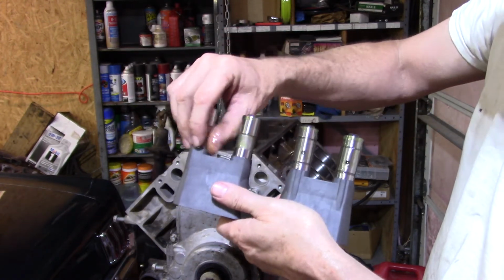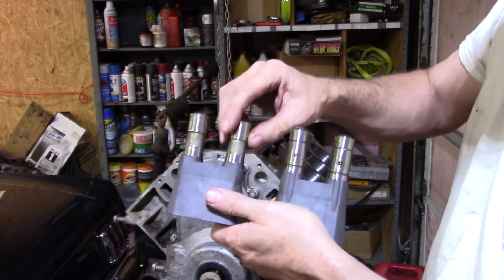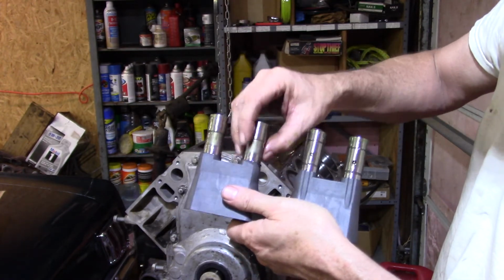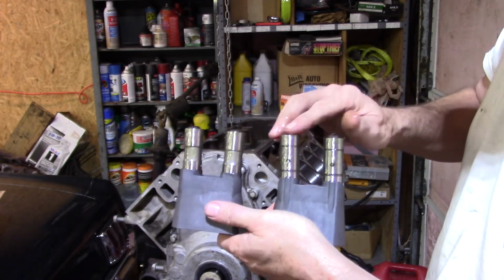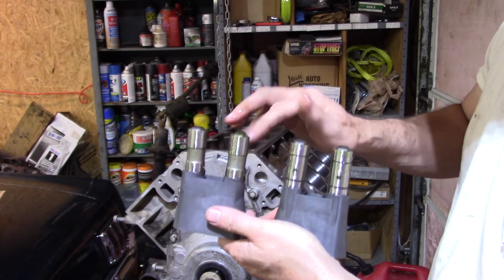Well, actually all the new oils aren't having any ZDP zinc. I know the new engines with the rollers are not supposed to need them, but on break-in periods, I don't think it's a bad idea to do it.